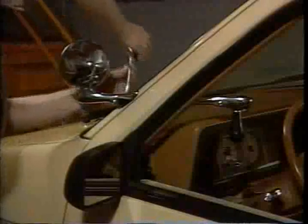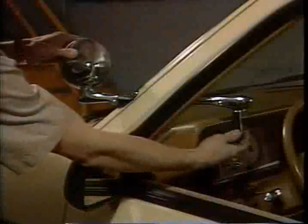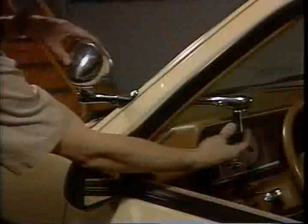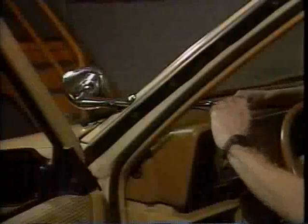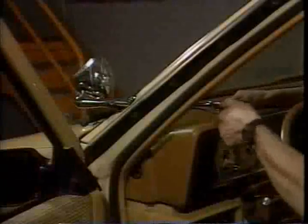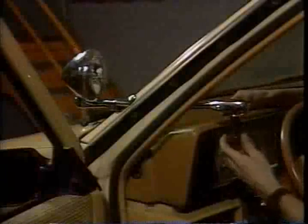To set the head clearance, slightly loosen the head housing clamp screw about a quarter turn so there is a slight drag. With the handle against the stop in a counterclockwise direction, the light beam should be in a slight skyward position. Confirm clearance by checking that the door opens without hitting the light. Tighten the wedge screw. Move the handle against the stop in the clockwise direction. There should be clearance between the head of the light and the windshield or body of the vehicle.